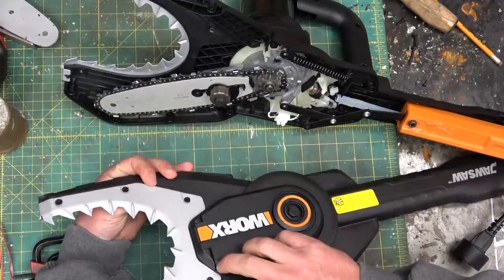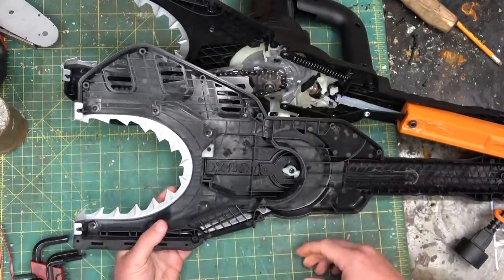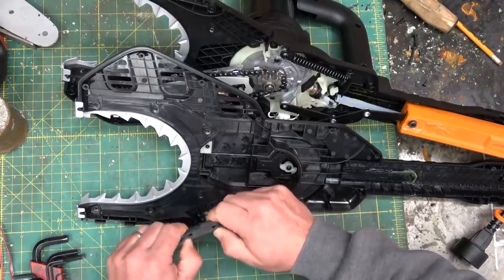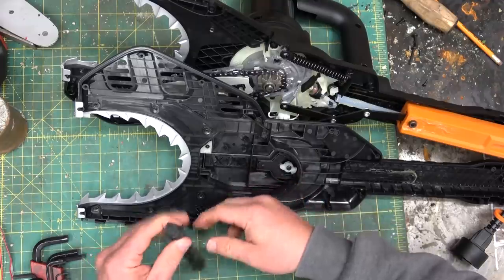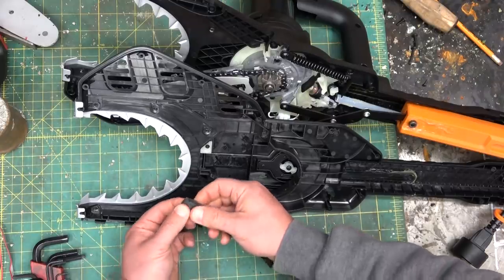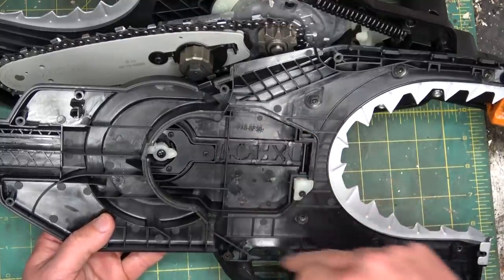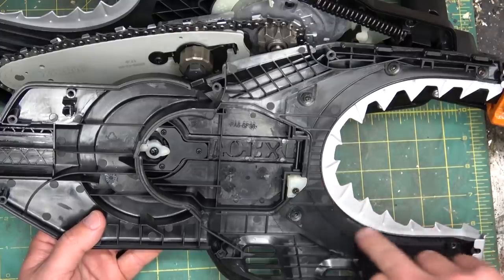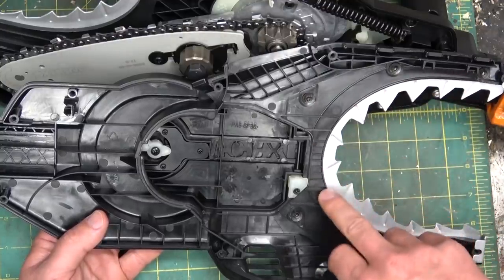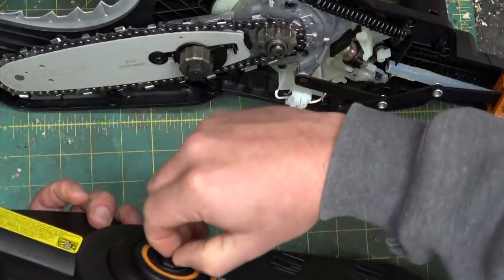The pressed and punched and formed metallic teeth here really stiffen her up. And then we've got a rubbery-ish bumper on here. That actually feels like rubber, but it can't be. No, it's molded. And that's got a factory blemish there, clearly. Now, this is a fairly labor-intensive clamshell here. We got a number of sub-assemblies in addition to these teeth needing the rivets with the big washer. So all that needs to be riveted in. There also is some handwork here with, I believe that's an access cover for something or other.